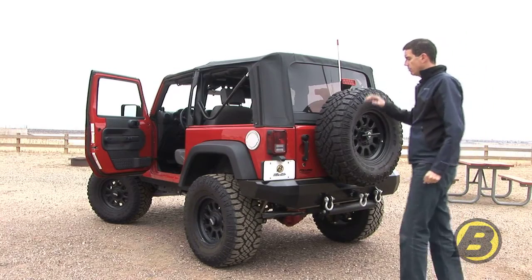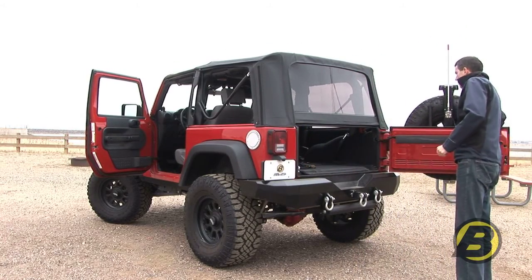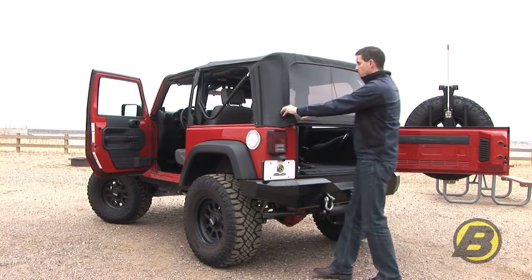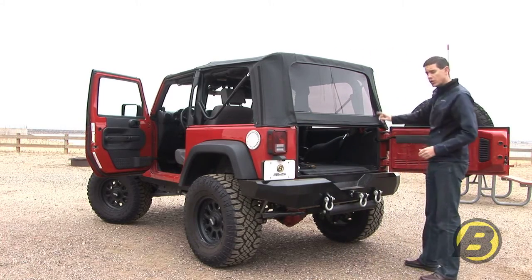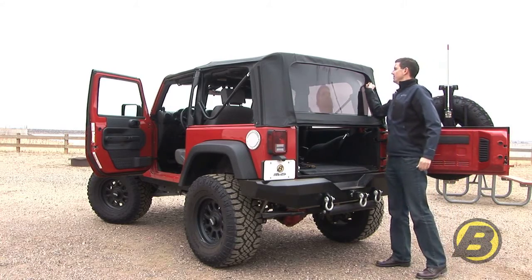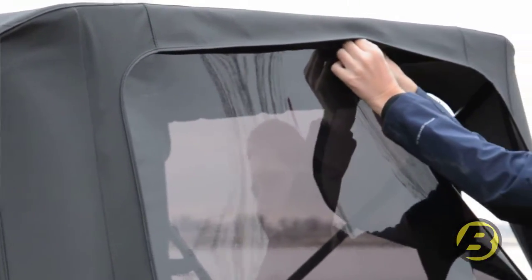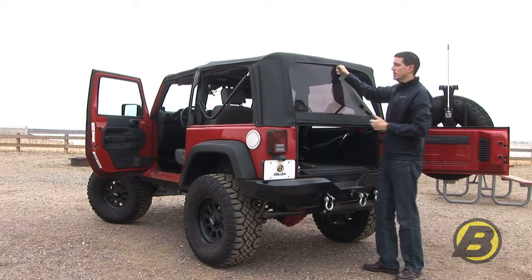To take out the rear window we need to open the tailgate. Protect the sail panels — we just need to release them slightly, the first three or four inches, so we can expose the edge of the zipper on both sides. Starting on the right hand side, release the zipper, taking it round. As you're opening the zipper, if you get to any point where the zipper sticks, just ease it past that point. Work it past. If you use too much force you can damage the zippers.